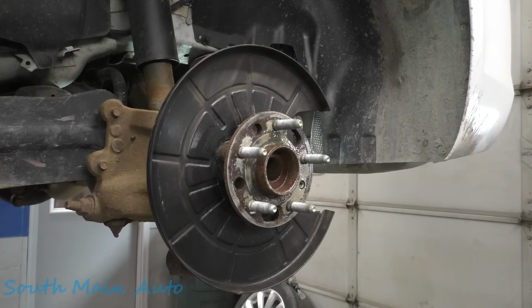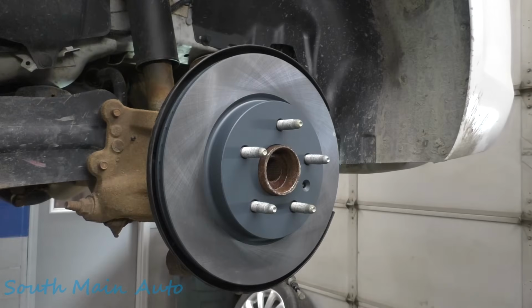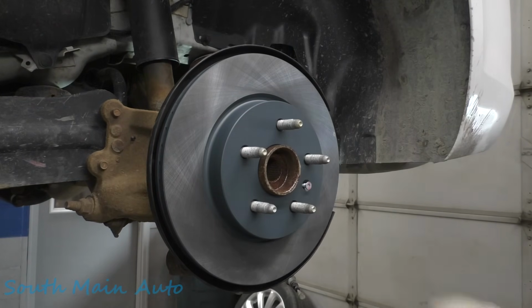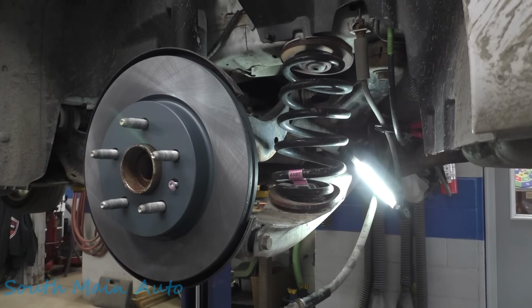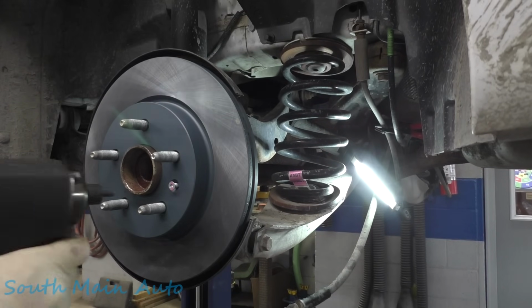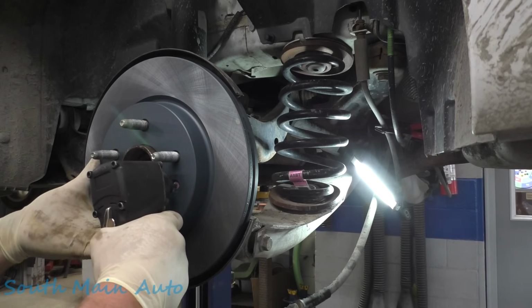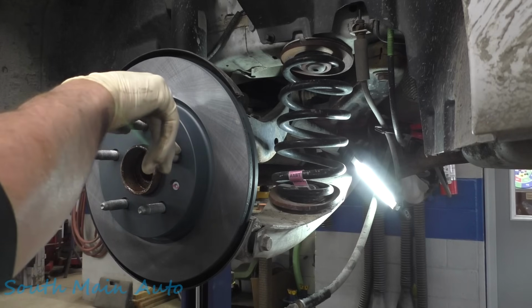And then we'll grab our new rotor. We'll slip that baby right on there, like so. We'll grab our rotor screw. And we will torque that down to 89 inch pounds. Or just a real light snug, a torque setting number one on the impact. Exercise trigger control. Whoa, right there, that's it. That's 89 around the money. You can tell by the sound.